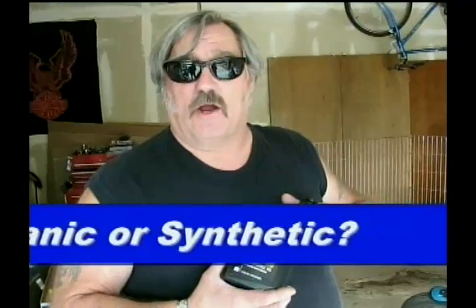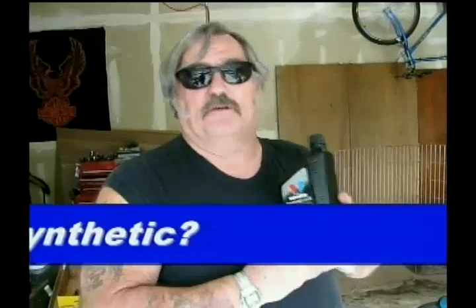Well, it is, because if you're going to use a synthetic now, Scott Yamasaki recommends a synthetic for the Evo motors, for the twin cam motors, whatever. He's running synthetics, Mobil 1, and things of that nature. I have always stayed with fossil oil. I'm going to try the synthetics this year just to see how it works. The truth is in when you drain it after it has 2,500 miles on it. What does it look like? Feel of it. See if there's anything in it. Do you feel any grit? What color is it? It's a nice caramel color, instead of this black sludge that sort of rolls out of your motor like the knuckleheads used to do. So there you have motor oil. Very important. Wonderful product from Valvoline.